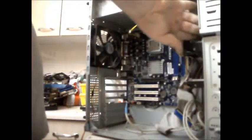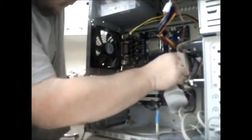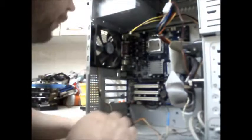See, this is the cable I don't need. I can perhaps just tuck it up there out of the way. Just lay it in the CD-ROM bays. What's this? Right, that's hard drive. Had to check which was secondary and which was primary. It's round the other way on this board, that's your secondary. So, that's what your CD drives connect to. Your hard drives go on the primary. That's those. I haven't got a floppy disk drive, so I haven't got to worry about that.